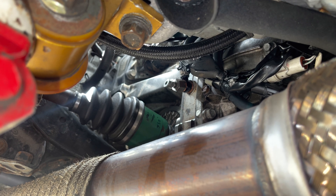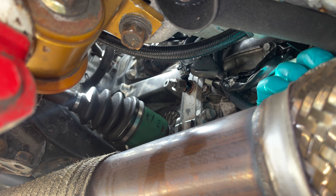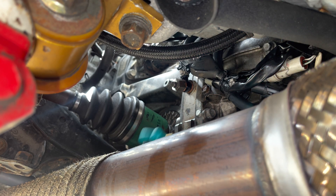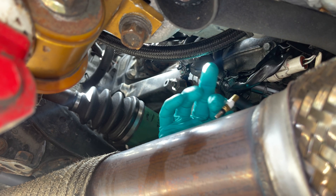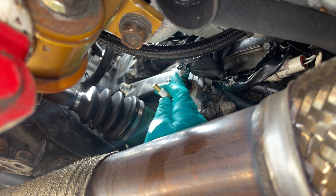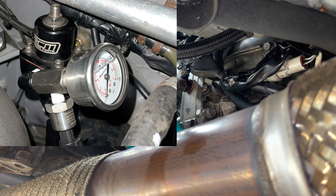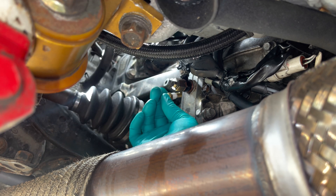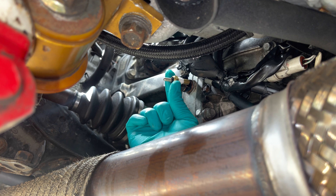I've just checked and we don't have clearance — I'll move it eventually. As I was saying, I wanted to swap this bolt with the back one, but with the sensor in the end it's going to foul on the tunnel of the car. We need a 90-degree one-eighth MPT elbow, same as I've got on the fuel pressure regulator. For now I just want some gearbox oil temperature measurement for Donington at the weekend, so we're just going to take this 10mm out and put the sensor in.